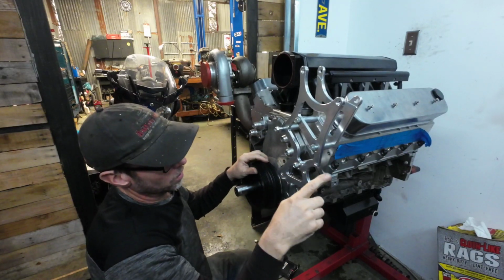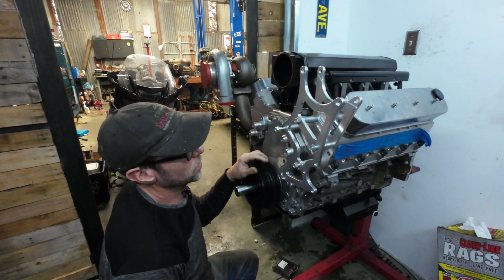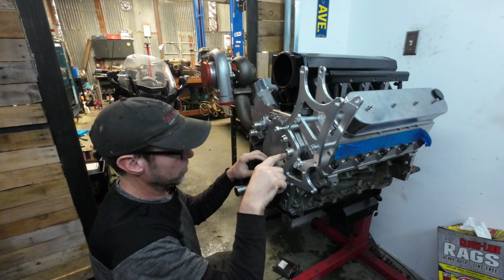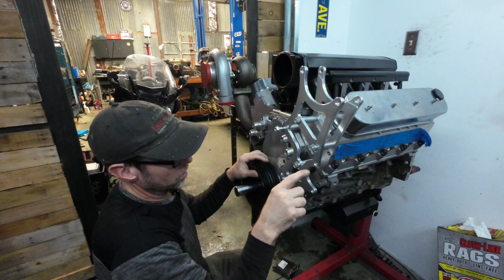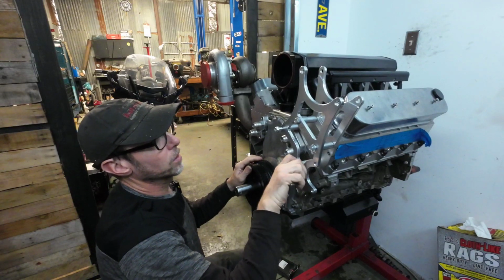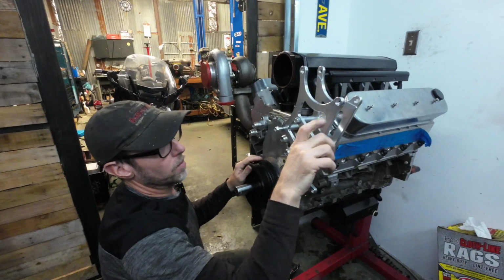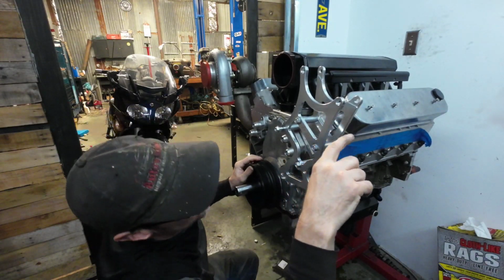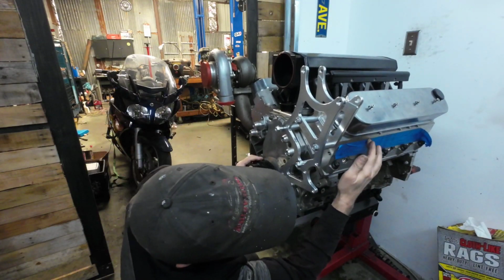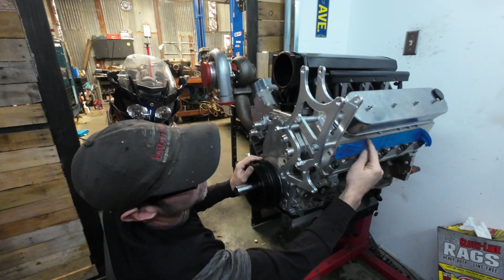All right. I got to figure out here how big a diameter that power steering pump pulley is before I can put, it's going to need an idler to bring this belt back into here. I just don't know what's gonna or not gonna work. None of the other stuff is really all that concerning. And I might build a bracket to come off of here and maybe brace back into the head somewhere, like right here. These accessory bolt holes right here on the back of the head.